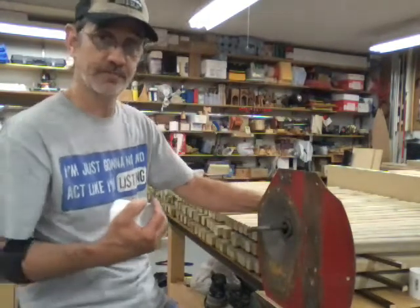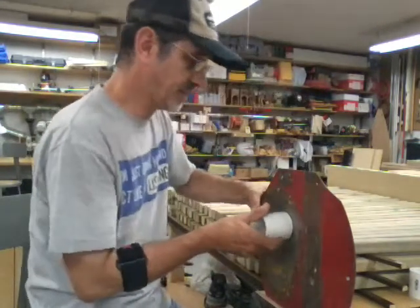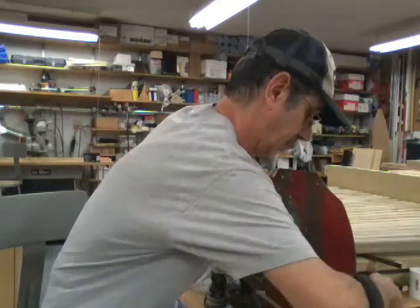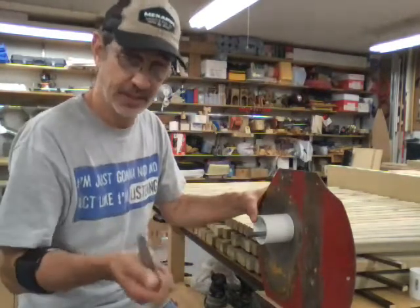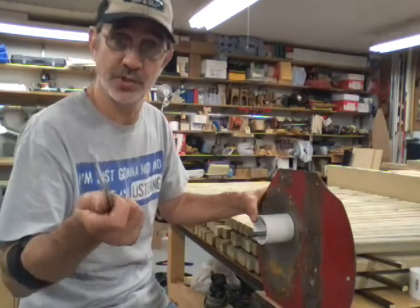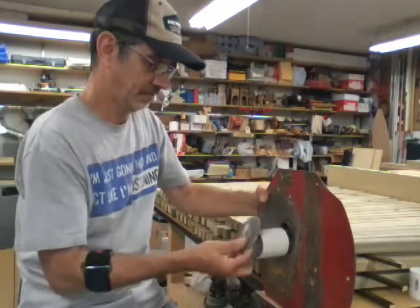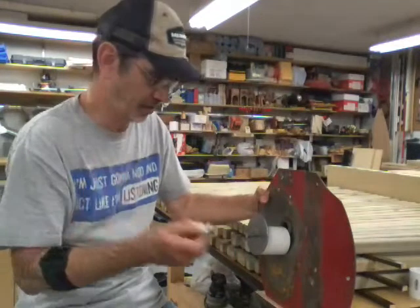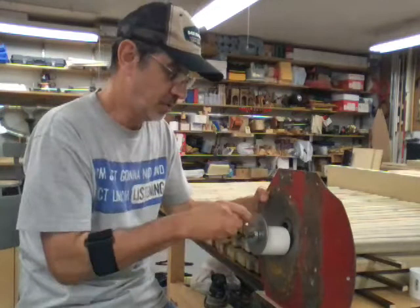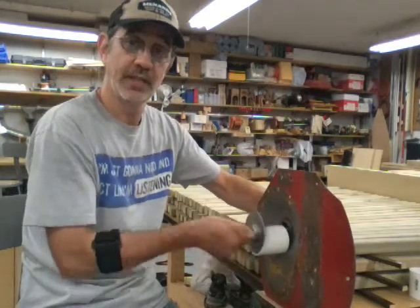You want to shove the rod through from the back side of the bushing, the direction you want to push it out — or in this case, pull it out. Put your coupling on. Now I use this a lot, so instead of the electrical covers I cut out a couple of circles from 10 or 12 gauge sheet metal using a hole saw at the shop. You put that on your threaded rod, then add three or four half-inch washers. Drip a little oil between the washers and it acts as a bearing to help you get the torque you need to pull the bushing out.